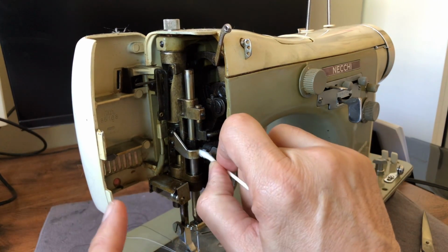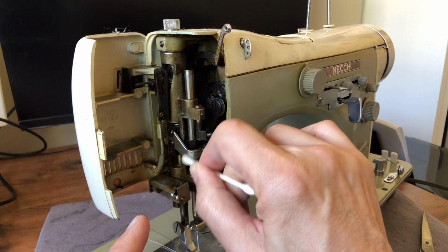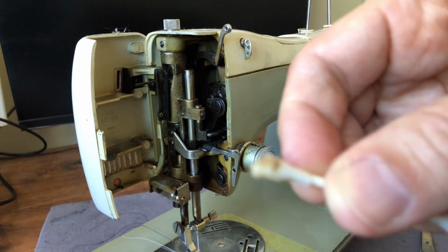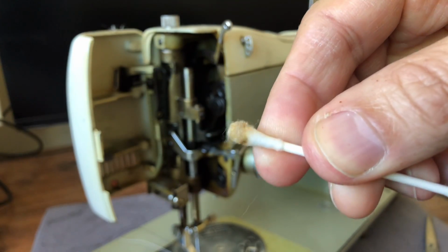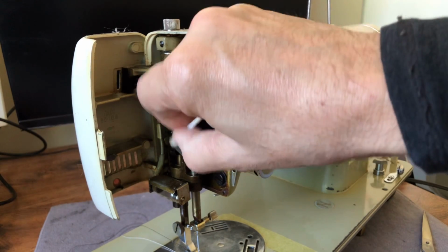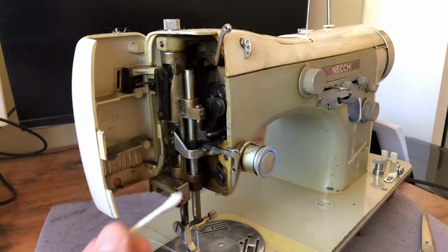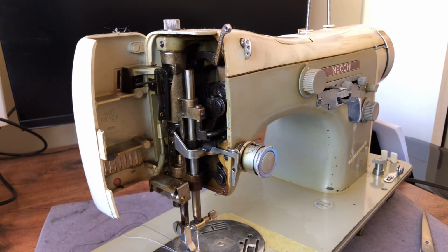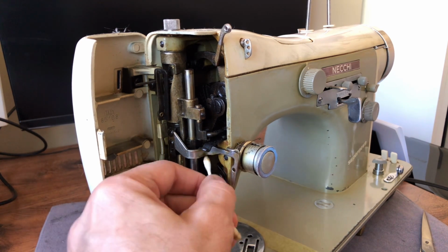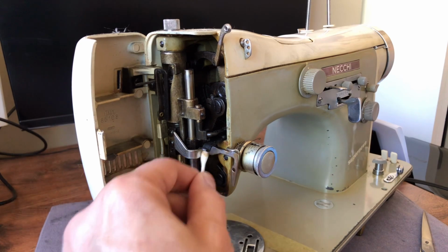It can trick you, because sometimes if the oil darkens, if it gets really dark, typically the old oil is a tad bit more amber yellow than rust is, but it's awfully close. I've been tricked myself, and you might too when you're looking at it. So again, don't assume that your machine has rust, but don't assume it doesn't, right? So how do you know?